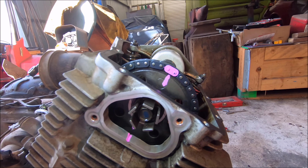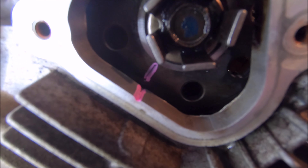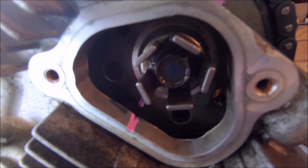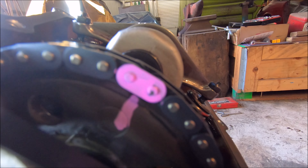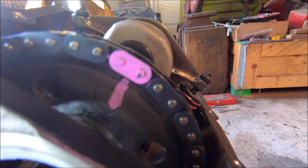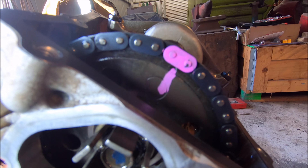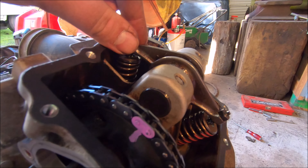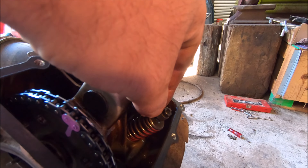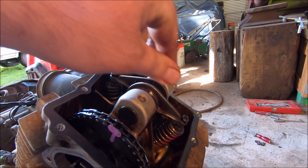What I've been doing is just turning the engine over. If you see down the bottom there, there are two marks - what I'm assuming are the timing marks. I've spun it around quite a few times and you'll see where that coloured bit of chain is - that bit of chain was a different colour to the rest, more silver than black. I assume that needs to be lining up with those marks. I've got it on top dead centre, so both the rockers there have that little bit of free play where you'd make your adjustment. They're both loose.